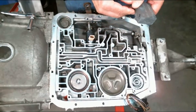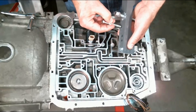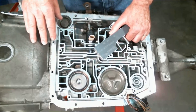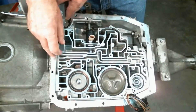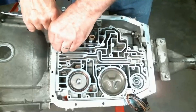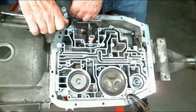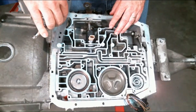To use the tool on the 1-2 accumulator, use this back hole here and this one in this location. The bolt will be unsupported on one side, so when you use it for the 1-2 accumulator, use this hole and this hole and line it right up. Get both bolts in there, but tighten the bolt that's furthest away from the pinch bolt first — go ahead and snug up this one first. Again, you don't have to get wild; all you're doing is just snugging it up. Then this one.